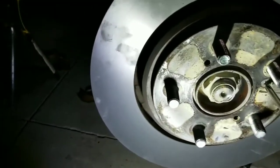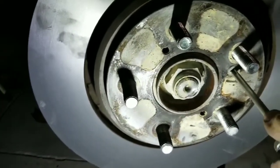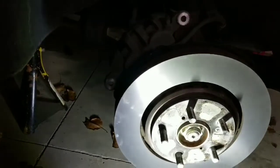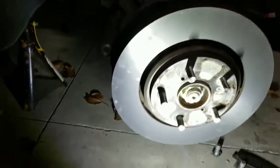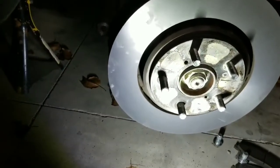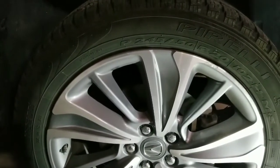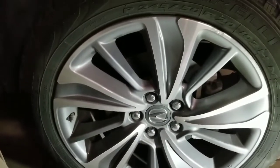This is the passenger side — just put on the rotor. Now I'm tightening this screw as tight as I could. I'll put the brake caliper and bracket on and clean everything with brake cleaner. I'm also putting lube on and cleaning it off with a wire brush as I put these on, so it's good and clean. The passenger side is now done — rotors are turned, everything's cleaned up, brakes are back on. Now I just need to clean up my mess and take it for a drive.